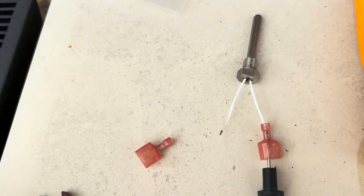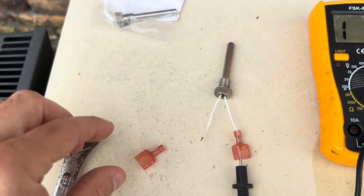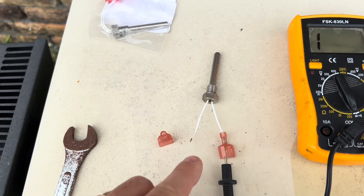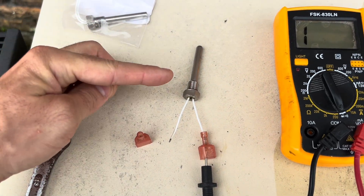So what we're going to do is get a wrench to take this out and get a multimeter to check it — see if it is working right or if it's busted. I got this sensor out using a 13mm wrench; I was able to loosen it up a little bit and then twisted it out. When I was pulling this out, this piece fell off really easily, so I'm guessing this sensor is my issue and this piece was loose, so we weren't getting that proper connection.